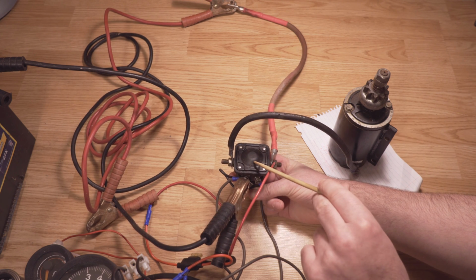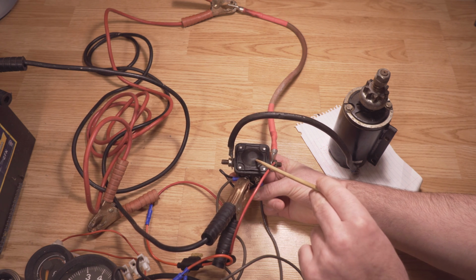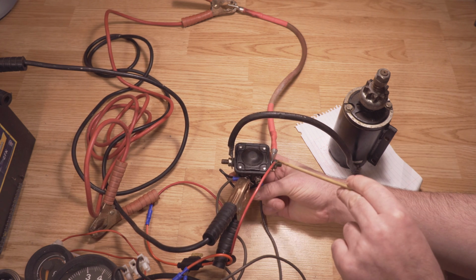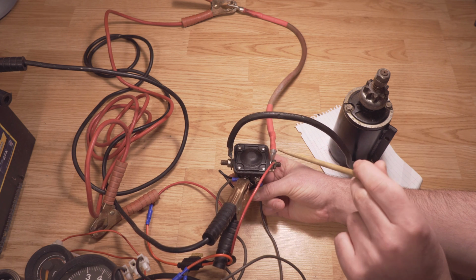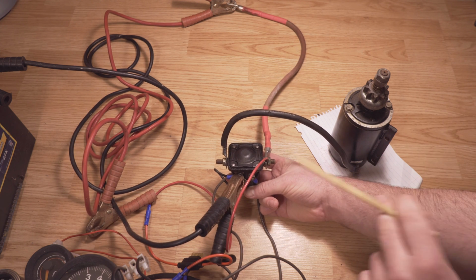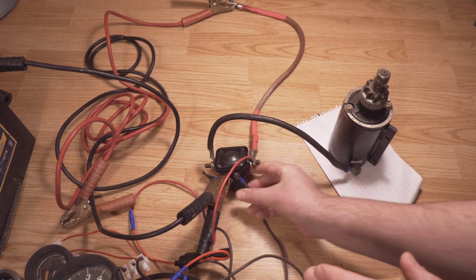Normally when you turn the engine key and you expect the motor to be on but not crank, this activates power through the key and provides power to your system through this wire. This is why your starter isn't always running. Now when you turn the key, it will send 12 volts to the screw here, activating the solenoid. But in the normal state, the solenoid is not connected. Battery runs directly to your ignition or your key.